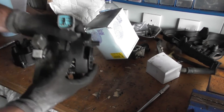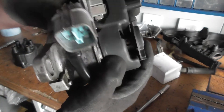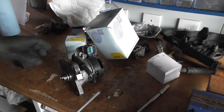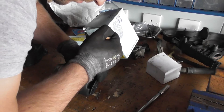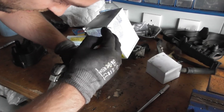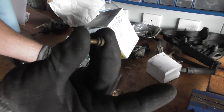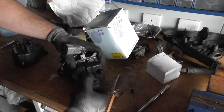With the cap off, the arm is exposed. In the back there's a posi-drive screw that holds it on with a little opening — you want to line that up so you can get the screwdriver down. Push down quite hard then turn. Sometimes they're Allen bolts; in this case it's a screw. Then just ease the rotor arm off.